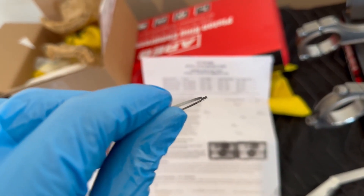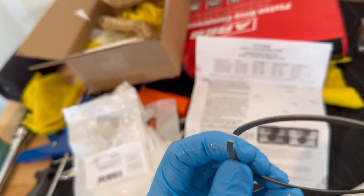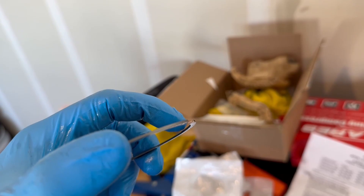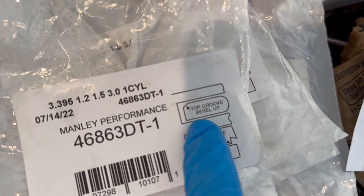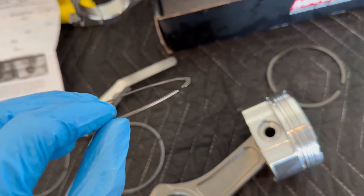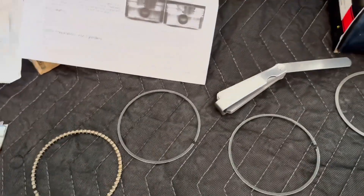The bevel on the top ring is very hard to see. It's easier to see on the side you didn't cut - and I would not recommend cutting both sides. One side has a curved edge and one has a solid square edge, so you can see here it has a corner and the other side the corner is gone - it's kind of rounded - so that rounded side faces upward when you install it.